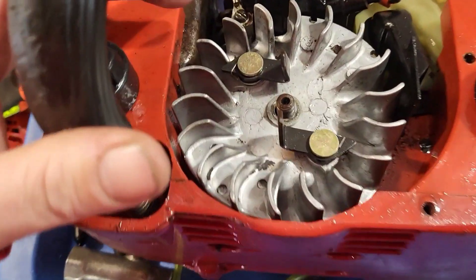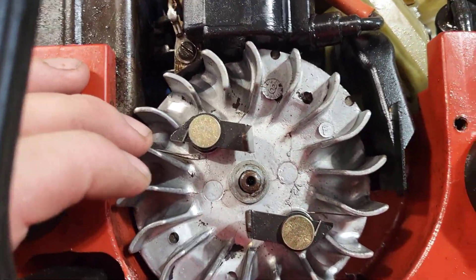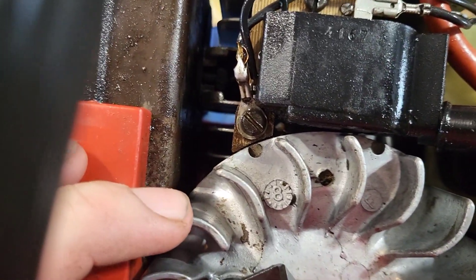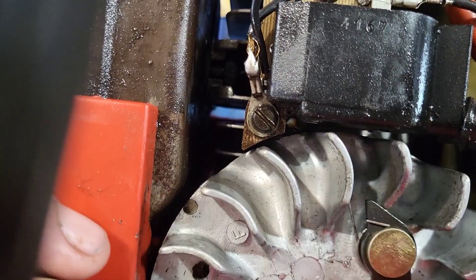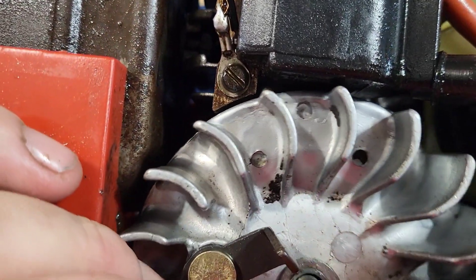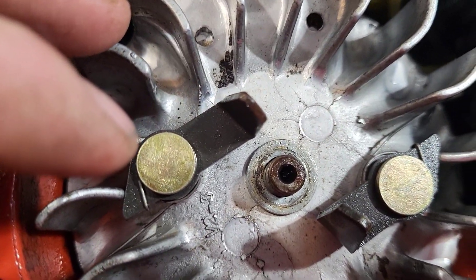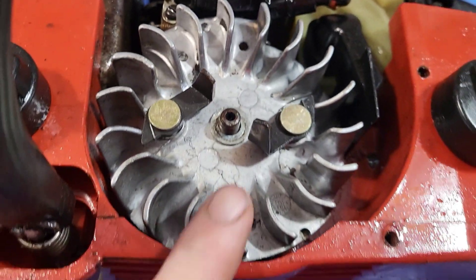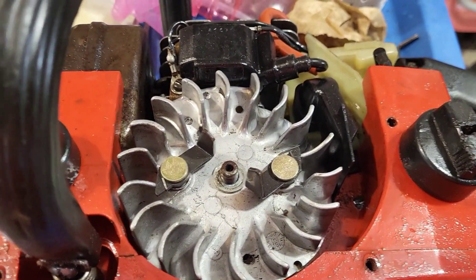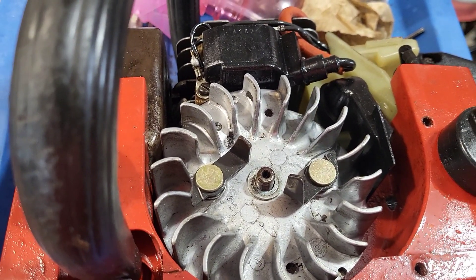After a little closer inspection — it was acting like it was out of time. It looked like the flywheel wasn't quite centered. You can see the gap there — hardly anything. Watch, it gets bigger. Look, there's a gap over there but no gap there. So I think this has cut the pin. I'll have to pull that off.